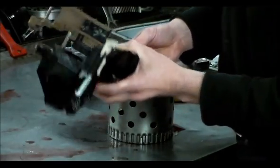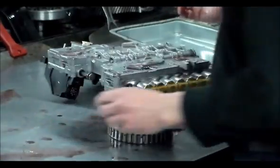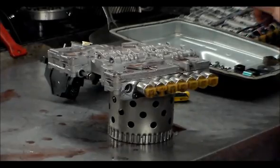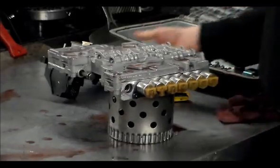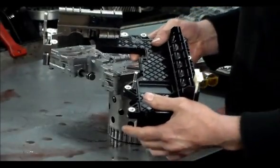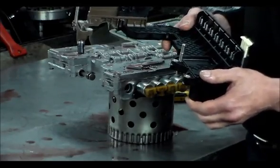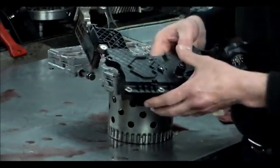We'll just kind of go over what's on the new one — point out the sensors and stuff like that. Back when these first came out, depending on the engine size, maybe as early as 2006, these used to have the TCM incorporated in them, but not anymore — they moved it. It's now part of the PCM. I think that lasted until maybe 2010. This 2013 model does not have the TCM in it.